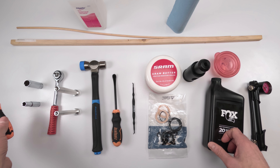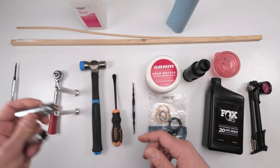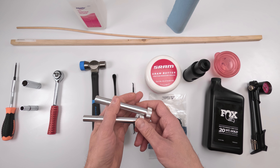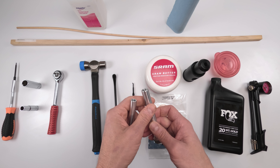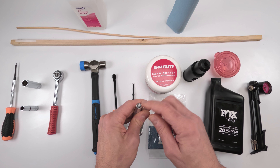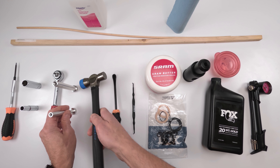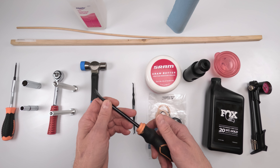To start the actual dismantling, you'll need a 2-millimeter allen to remove the rebound knob. Then you'll need a 10-millimeter hex and a 15-millimeter hex with a ratchet to loosen the screws underneath the boots. These shaft separation tools are technically optional but make life easier - they help you separate the internal shaft from the lower boot. You can make your own with couplers. A mallet is used to tap the shafts into the boot to separate them.